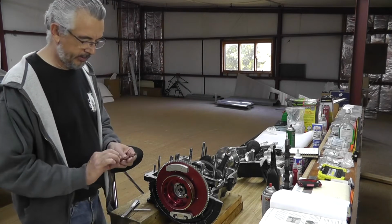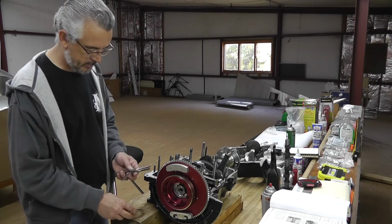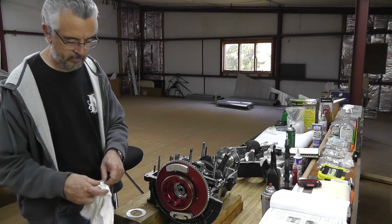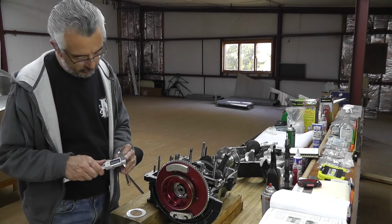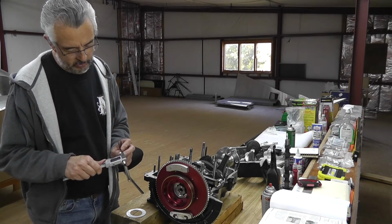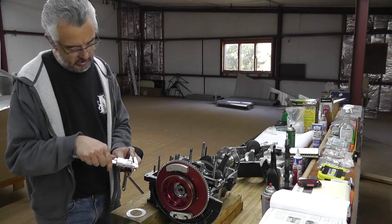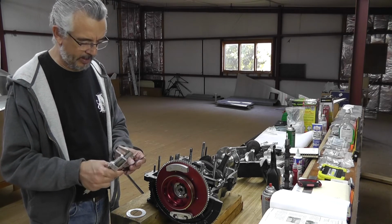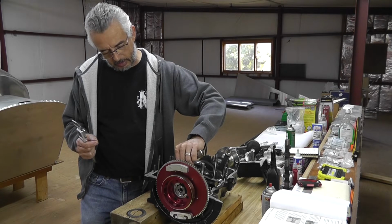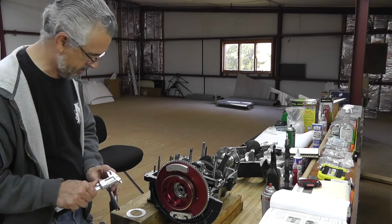All right. Somebody did math wrong. I'm going to double check the tools. Ah, so what says 32 is really 31, and what says 30 is 29. So these seem to be a thousandth undersized. The two of these together have drag, 61.